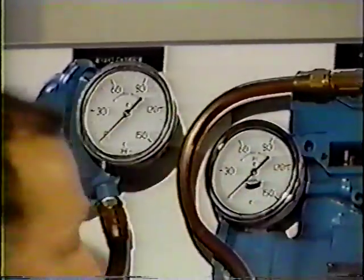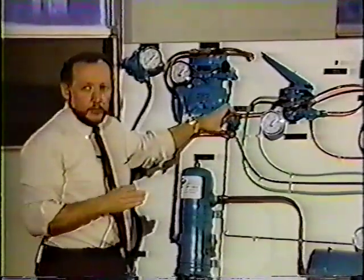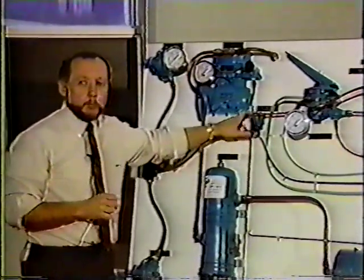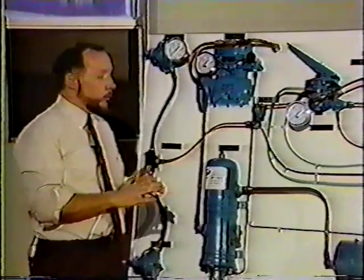So air pressure on the front BP1 actually shuts the valve off, and any pressure that enters it, that exact same amount will be delivered. So this valve at this point, in this mode, isn't doing anything whatsoever. So we have full pressure on the front axle, and we've limited that rear axle pressure by about 75%. The driver gets the feeling that he is actually hauling a trailer when he touches his brakes.